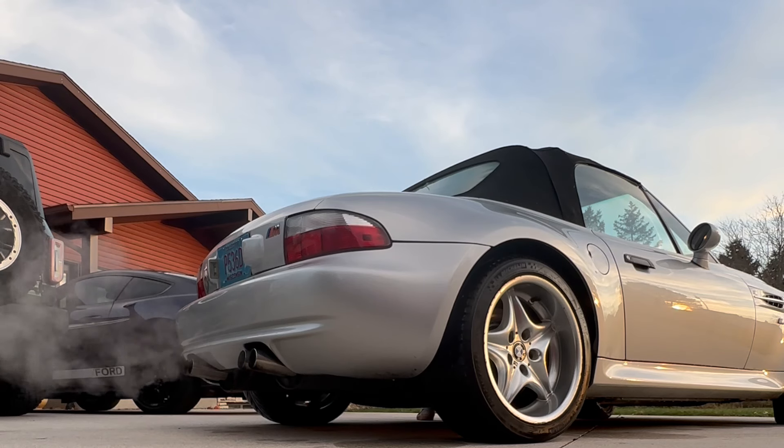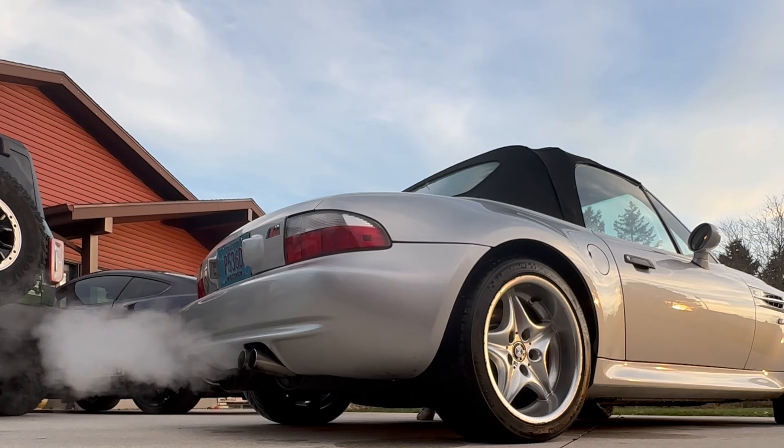The problem with the BMW is I'm noticing a little bit more smoke than what I think would be appropriate. My car sits a lot — it only got a couple hundred miles put on it in the last year. Condensation is very possible and probably some of the smoke we are seeing is because of condensation from the exhaust. But I want to be sure that there's no water entering our oil. Yes, we need to drive the car more, but it's negative four degrees outside right now.